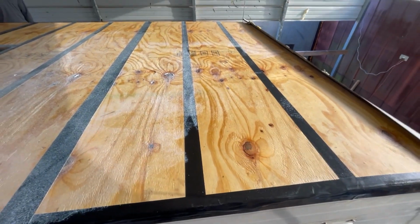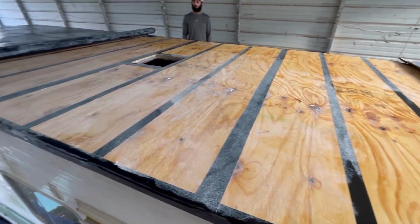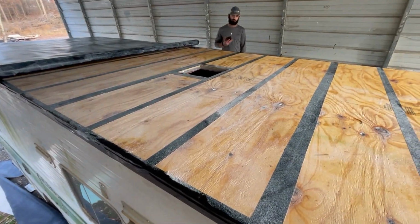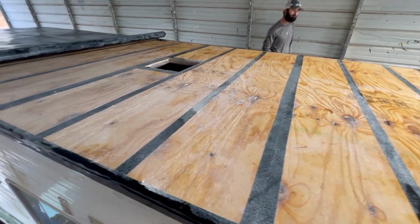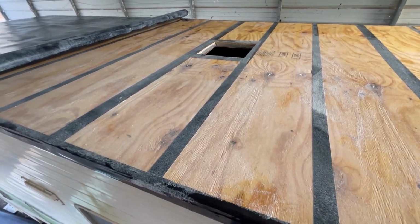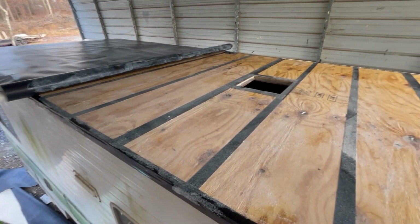Once that starts drying out and the white starts disappearing, then we'll roll that heavy 40 mil Carlisle TPO on there, and when we roll it and get it down, it'll be solid. If we put it down wet, which we do on some of the extreme ply PVC, that allows us to move it around and get it right, but we don't want to do that. That stuff's so thick that when it goes down, we want it to stay down.